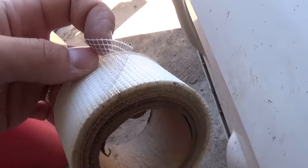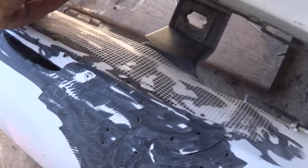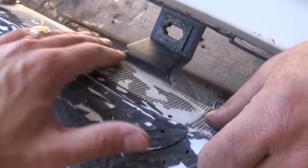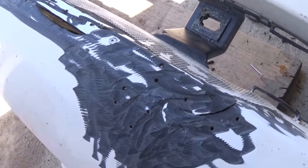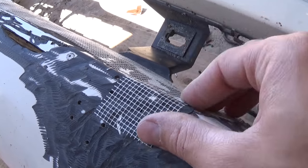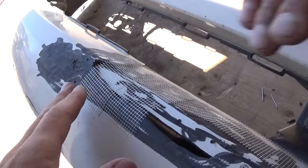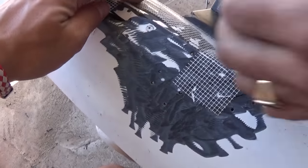We also grind and clean the little crack with small holes. If you need mesh, you can get it from the lumber store — it's the drywall mesh, about one dollar for a whole big roll. We cut a piece and apply it here. You can also use gauze. This will make it really strong because the epoxy goes into the little pores and holds well — similar to fiberglass. It'll be stronger than the original bumper once we're done.